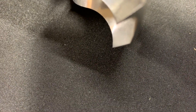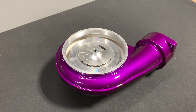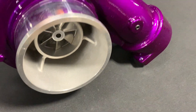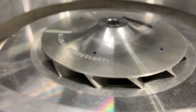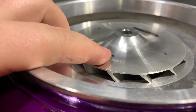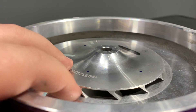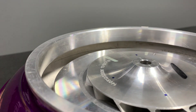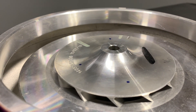That extended portion is not completely flat — it's not at a 90-degree angle with the back side of the compressor wheel. I have a compressor cover here with the compressor wheel inside so you can see where these tips exist. Your shaft and bearing housing would sit here. As you can see in the cover, those tips with that slight extension give you more blade — more flap, if you will — to move more air. This is where boost is really being generated: fresh air comes in, the wheel spins, and the air comes off these blades right at the extended tip, pushing more air into the motor because there's more surface area to move more volume.